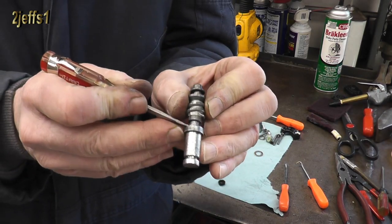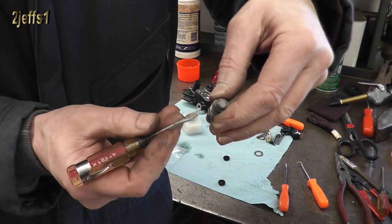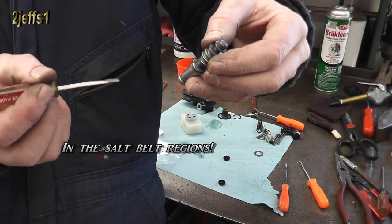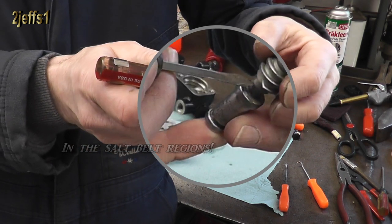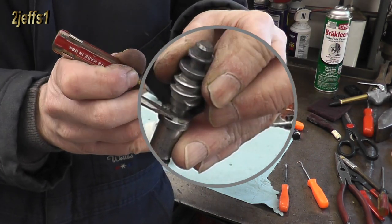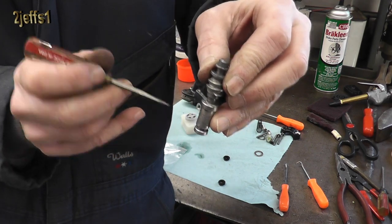See all this white skunky on here? That's like when you've got an aluminum wheel on your car and it leaks air. You've got to have two sealing surfaces here, like an L around there, and all this stuff has to be cleaned off while we're reusing that piston.